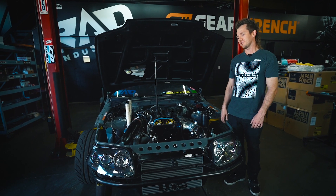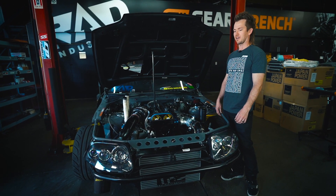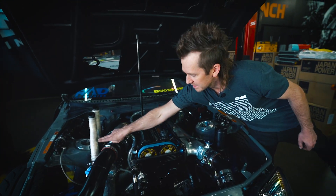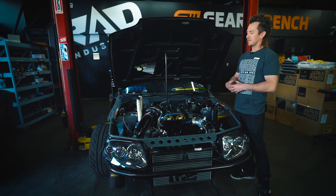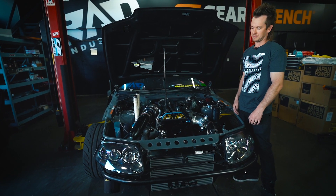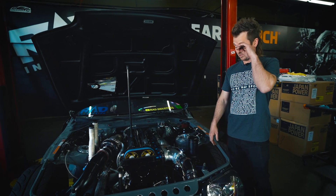On that side we have a cold air intake tube going down there for the AEM intake filter — that's the dry flow with the filter sock on there. The sock keeps everything dry if you splash anything on it. All the intercooler piping is connected with HPS silicone couplers and T-bolt clamps. I also run NGK Iridium spark plugs, the 8 series for the heat range — part number BKR8EIX. All the heat shielding is made by PTP Turbo Blankets. We work closely with them and utilize their products to keep heat held in where you want it, or keep it away from surrounding things so it doesn't burn up a hose or cook something else like your hood.